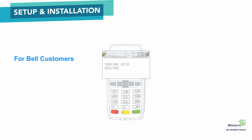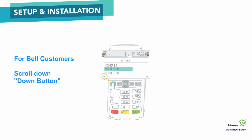To enter the 3G Setup menu, press pound twice, enter 1, 2 and press the green button. Press the green button to select APN. Scroll down to the option that reads MONVLPUB and press the green button. When the 3G Setup menu reappears, press the red button. The message connecting 3G, please wait appears on the terminal. Wait until 3G connected, press OK appears, then press the green button.